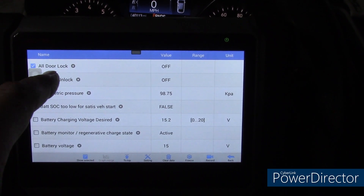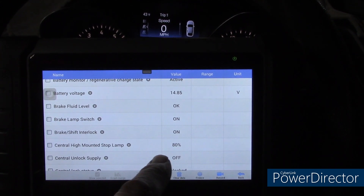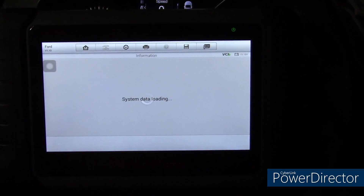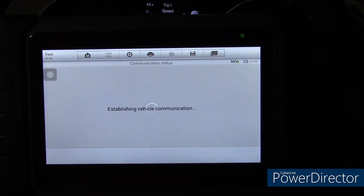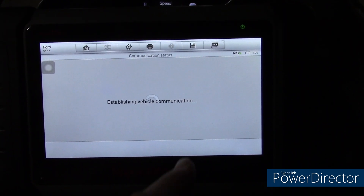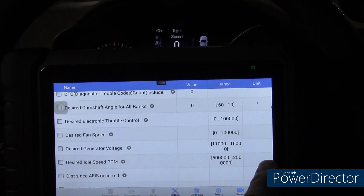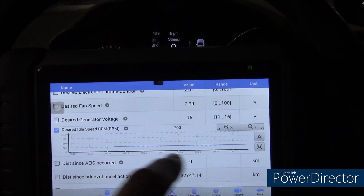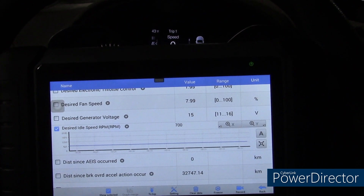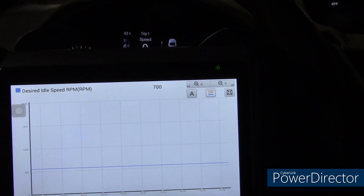Here's the main difference between the tools. I have selected all-door lock off. What you have to do in this case is go to the actual car to change the value. I'm pushing the brakes — you can see the data change. That's good. Let's try under control units — I've noticed more data there. This does have reset features as the D7 does. We can look at engine components — it's all here, it's just a matter of getting to it. We can probably find something. Let's graph this. If you push that button, now we have a graph available. I do like this as opposed to the meter because you have that history. If you had oscillating values or whatever, you could see what's happening a little easier than the gauges, and you can expand it to a full screen — that's kind of nice.